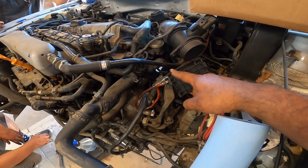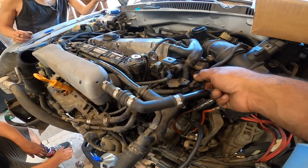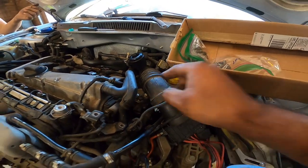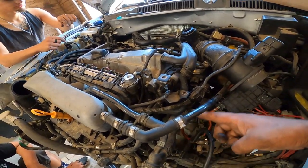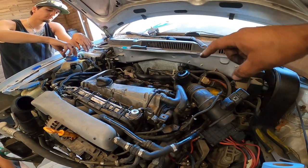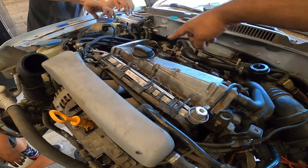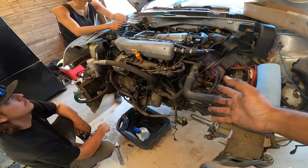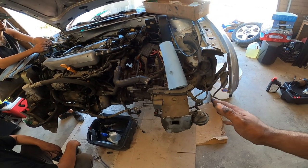which has the rest of the ignition harness, which goes over. And that one has the coolant sensor, the N75 on top, and then down below, if you follow it across, it goes over to the shifter, the speed sensor, and then it comes up over to the four cylinders, and there's a 10 millimeter bolt right here on top, and that's pretty much the entirety of the harness. And once we yank that all out, it should come out and sit right here on the driver's side rail.